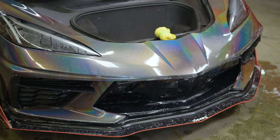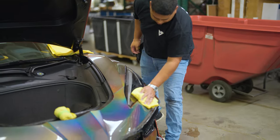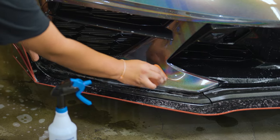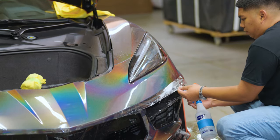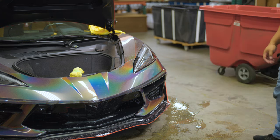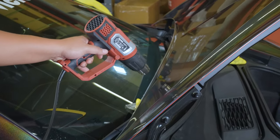So pretty much done squeegeeing. We're going to let the top edges dry out a bit so we can seal them with the heat gun — basically the next step. You want to grab a microfiber towel, wipe it down, check for any leftover moisture. Grab your tack solution, seal the bottom edges. So we're going to work our way back to this side, lift up our edges, flush out all your slip solution. Once we've got that, all we have left is pretty much let the edges dry out so we can seal them. There might be some trimming necessary because of all the stretching we did, but other than that just let your edges dry out so we can hit it with the heat gun. But that's pretty much the install part for the C8 front bumper.